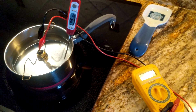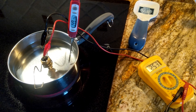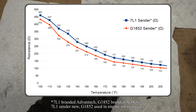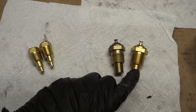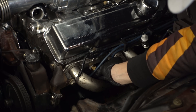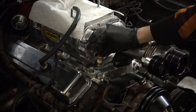I tested it in the same pot of water I used to test the switches, simply hooking up a multimeter to read the resistance of the sender. While the G1852 sender reads around 118 ohms at 195 degrees, the 7L1 sender reads around 140 ohms at 195 degrees. That increase in resistance means the gauge will not move as far, which results in a lower reading. I think the sender is just right and we'll have that gauge reading properly. And we'll install the 200 degree switch.